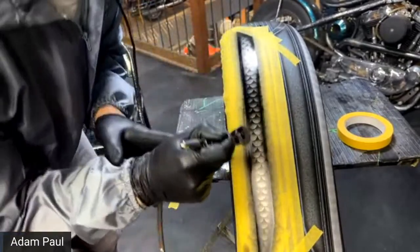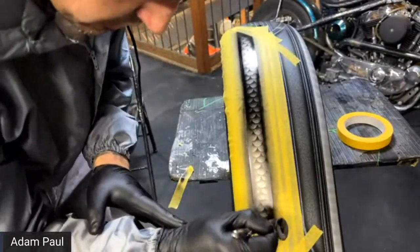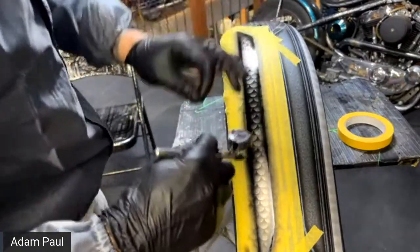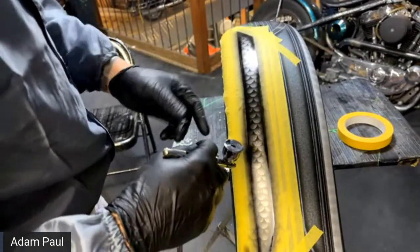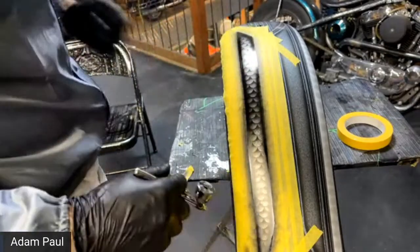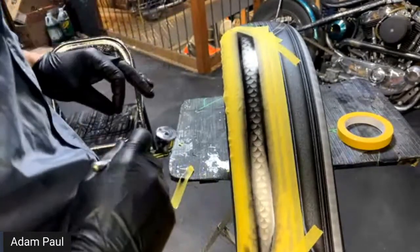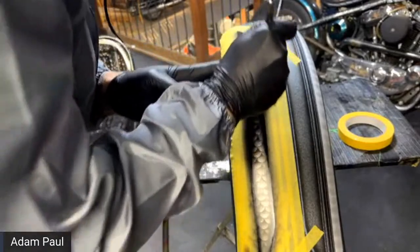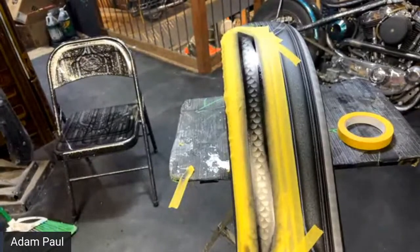Like I said, this is black paint that has a clear base coat, inner coat clear in it. So basically it's black base coat with clear base coat, and then it's reduced with urethane reducer so that it's thin enough to spray even. And I hope that makes sense for you. But the clear base makes it so it's not so potent. So it takes more to do less, if that makes sense. I hope that does. But that's looking pretty good there.